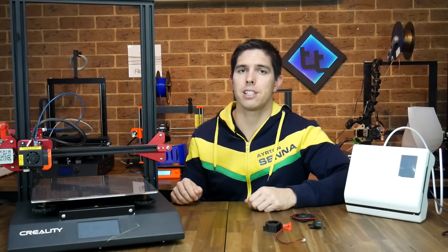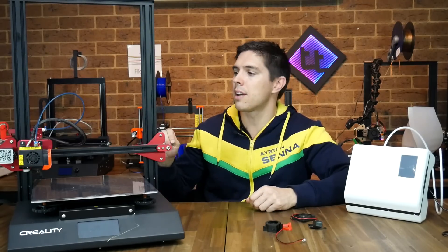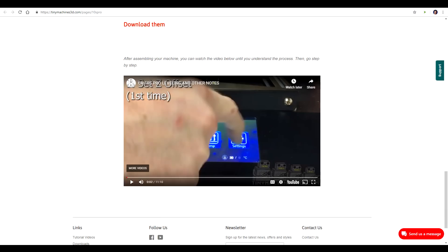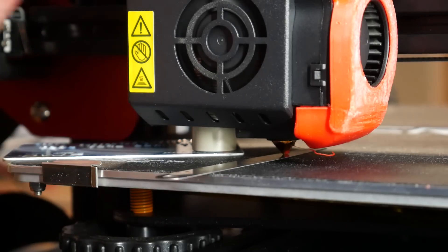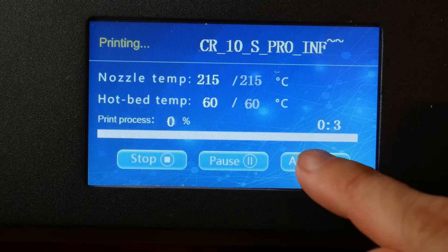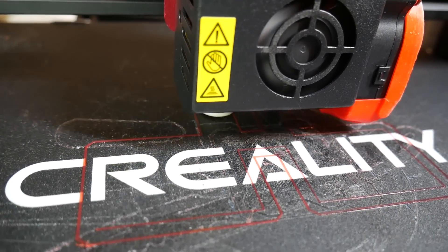Now for a big one: first layer consistency. If you read the community groups for this printer, it's something a lot of people have struggled with, and there's no physical end stop for the Z axis — it relies instead on a contactless probe. In making this video, I've had many prints with the perfect first layer, so here's what I did. When I reviewed the printer, half of my prints were too far from the bed and didn't stick, while others were far too close and left a permanent imprint in the bed. Linked in the description is a page from Tiny Machines with an excellent and thorough guide on calibrating this probe. I got my best results by having the shim underneath the nozzle and one of the little spanners from the toolset underneath the probe. Once I got that dialed in, the printer remained entirely consistent from that point onwards.